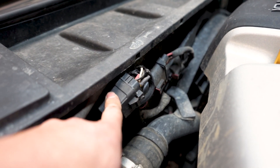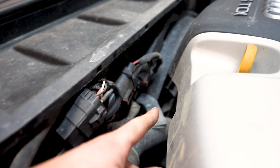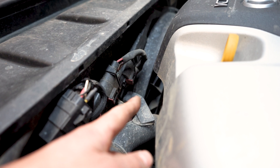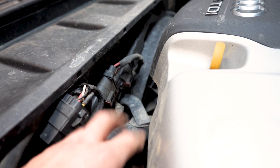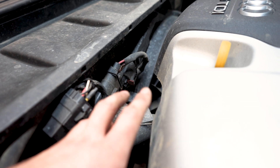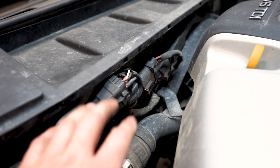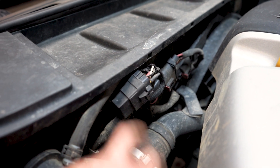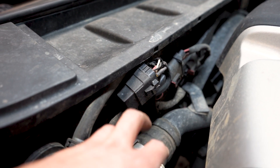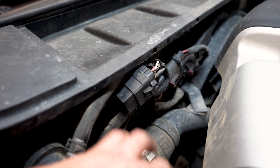When I flick my switch, the relay opens that circuit, and then the radiator fan — now it's lost communication. Give it a couple seconds and the fan goes to max speed. I don't run this for too long; obviously you heard that — they're screaming. So it's good when I'm using it, and then I just turn the switch back off. Communication is restored, takes a couple seconds, and I don't even have to do a key cycle — the fan goes right back to what it was doing.